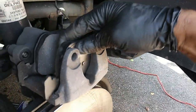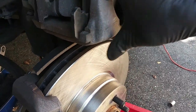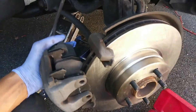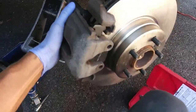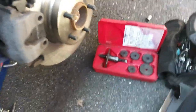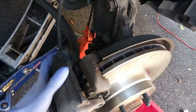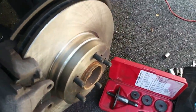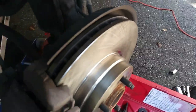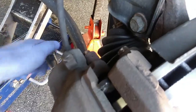That was the inner — now this is the outer one. It's good practice to put some grease on the ends of the brake pads when you're installing them. Also, on some of these cars you'll need to clean up the contact surfaces for the brake pads on the brake caliper bracket — use a little sandpaper to clean up the contact areas.